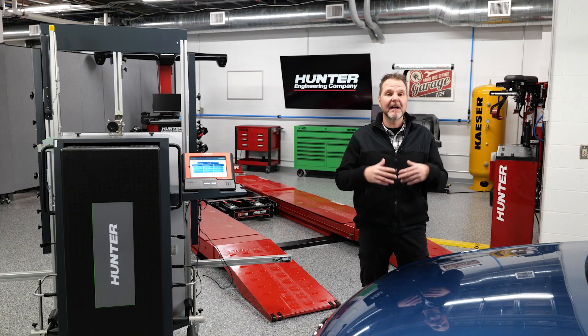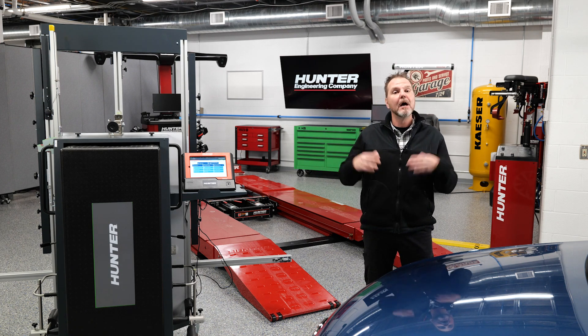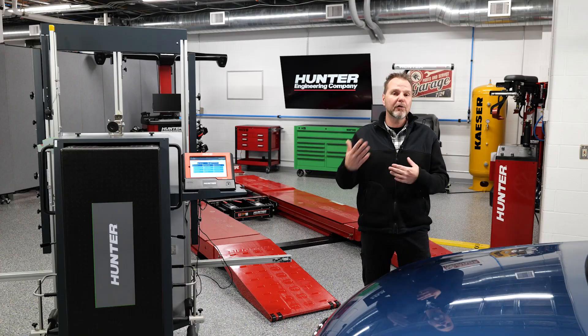I'm Joe, and welcome back to our series on ADAS calibrations featuring the Hunter ADAS Link and the DAS 3000 Hunter rack that we'll use for our calibrations. Today we've been brought a 2019 Golf Alltrack, which is a little bit of an unusual vehicle. The entire front end was hit. They did not see any reason or need to replace the front radar — it looked okay — but we know it was off the vehicle. Per Volkswagen requirements, anytime that's been removed, we're going to have to calibrate the adaptive cruise control system that monitors the distance to the vehicle in front of you. So we're going to go through the calibration on that.